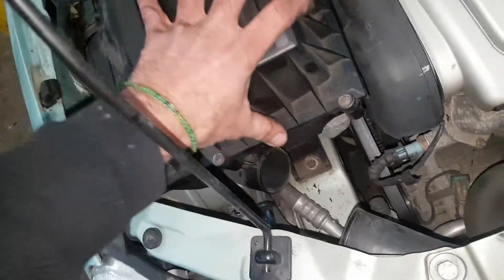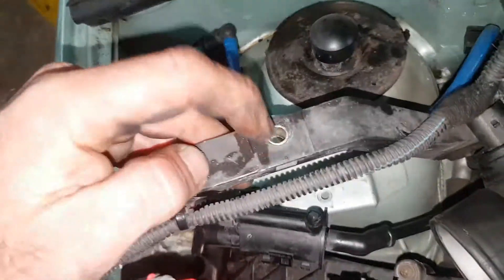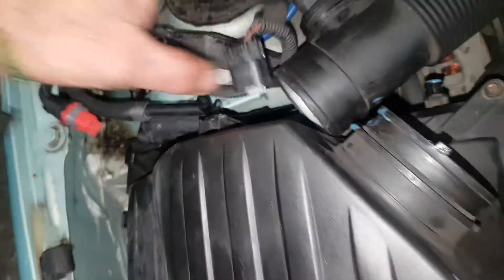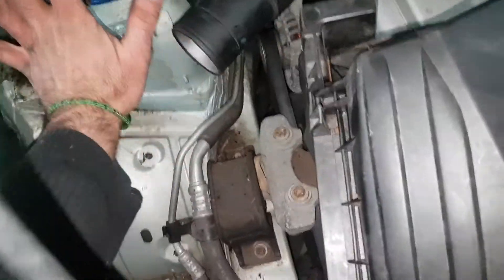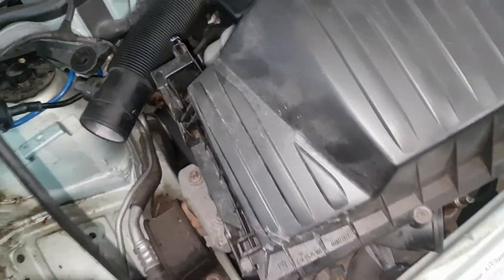There's also vibration on the body. So if you loosen the bolt and the little clip there, take this off, take this off, unplug that connector, and remove it carefully off the mount here and here, and clean all that up — that's how you do the airbox.